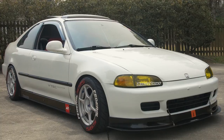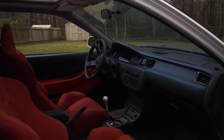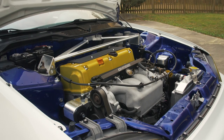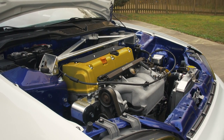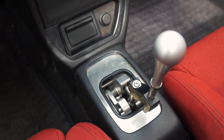It's a 94 Honda Civic EJ1, it's an EX model, two-door coupe — the Hijacker Civic from Fast and Furious. It has a K20 swap out of a 2002 Acura RSX, matching engine and trans. It also has the K-tuned no-cut shifter box, and it's on the JDM Type-R ECU, so there's no K-Pro.